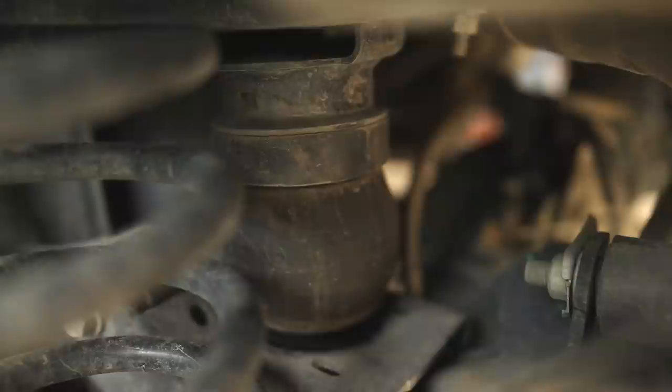Another thing I did to try to hopefully prop it up a little bit was to get thicker bump stops from Timbren. Compared to the factory, these are a couple of inches thicker. Basically, what ended up happening was the truck bed was actually resting on the axles. Now, unfortunately, it did kind of help a little bit with the sag. It did give it a little bit of elevation,